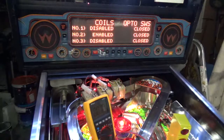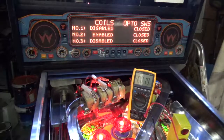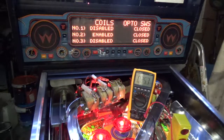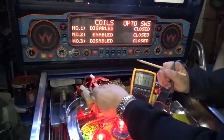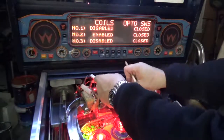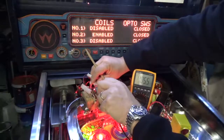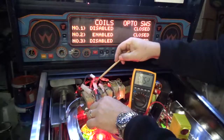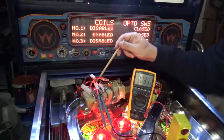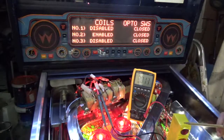And we're going to test to see what the volt reading is on this. So let's have a look at, take out number 2, we know it's working, and we're going to plug in and see what voltage is reading. Now, just to make sure, you can put the positive goes into the cable, which is green purple, and the red goes that way, and you get a positive reading. Without anything flowing, you should see approximately 3 volts going through it, but the moment the ball enters it and the magnet fires, you should see that shooting up if it's getting voltage.